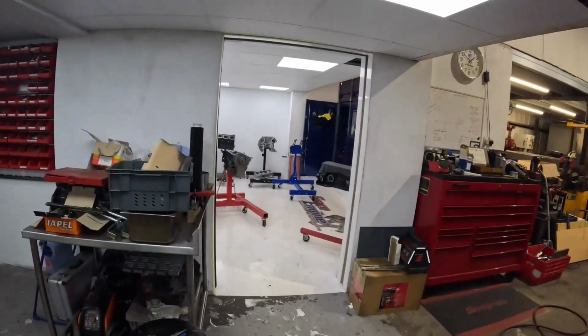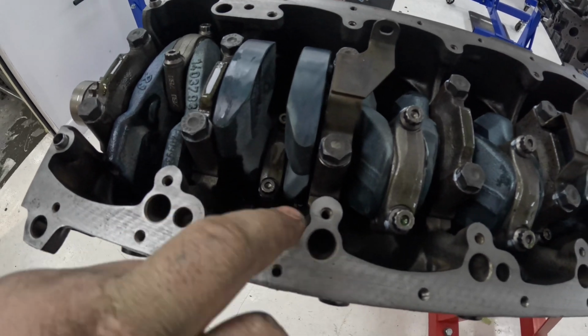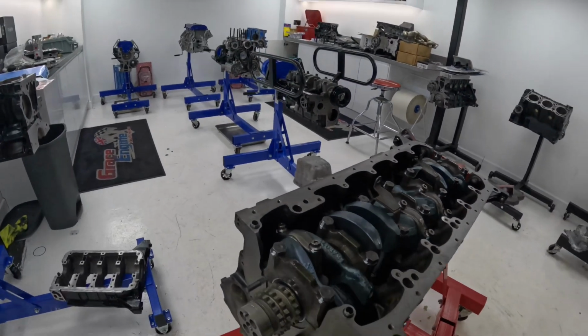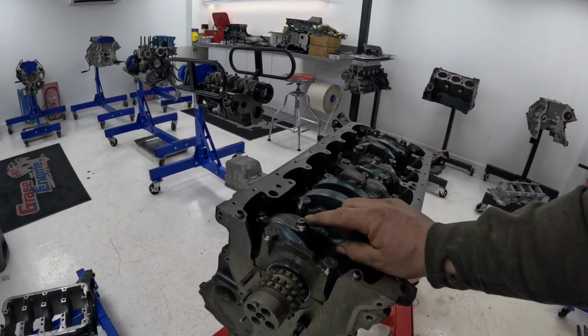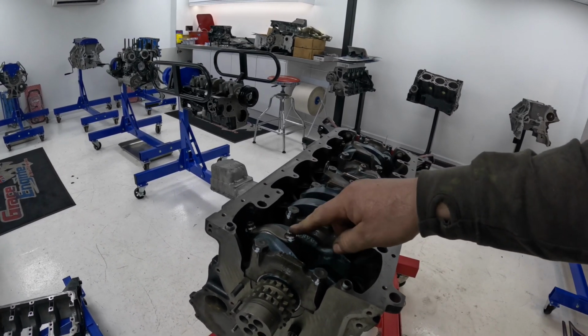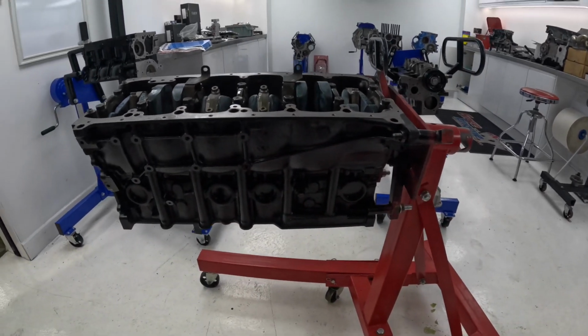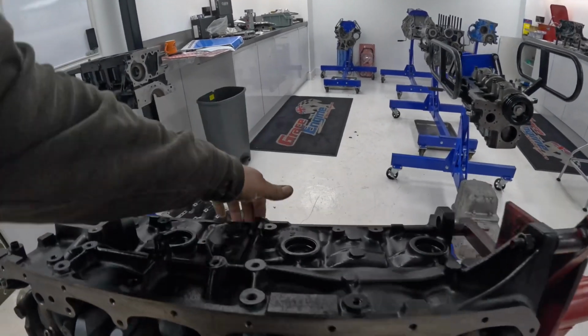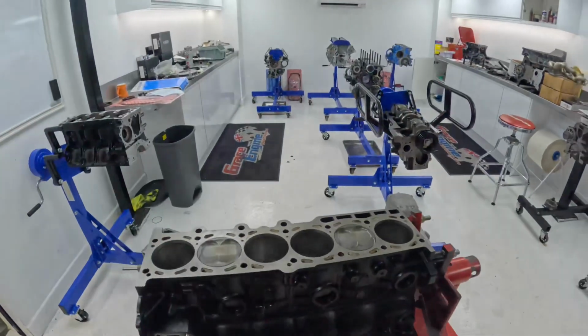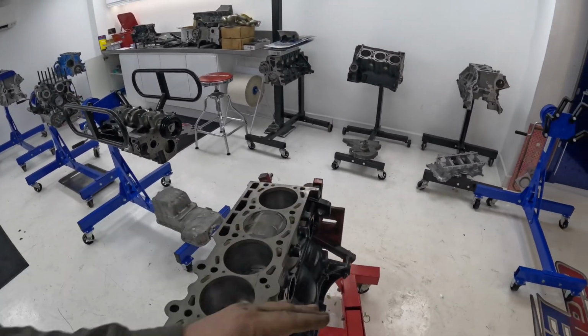And then the bottom end's all back together. I've just bolted in the bore squirters which are down there just to cool the piston and lubricate the bottom of the bore slightly. I put ARP big end bolts in this with standard main cap bolts, ACL bearings throughout. The customer supplied the big ends actually. I've pinned it all up, so that's all ready to go. The crankshaft's been polished. We gave it a little coat of paint just to make it look a bit better. I've honed the bores, given it a really light reface across the top, and new piston rings.